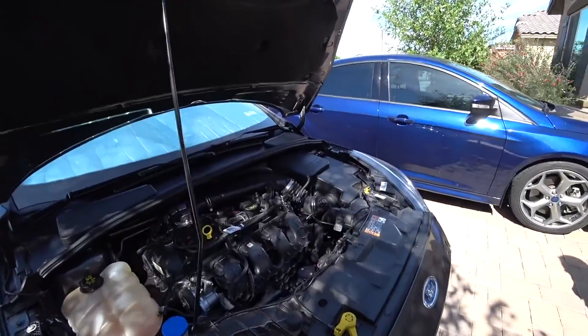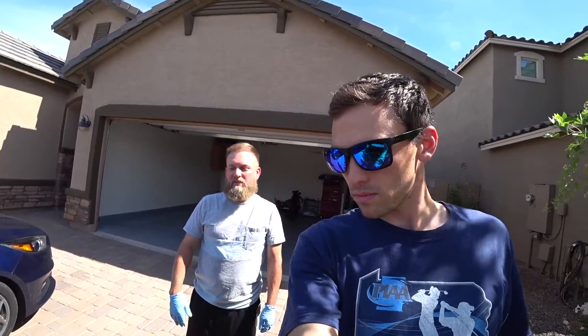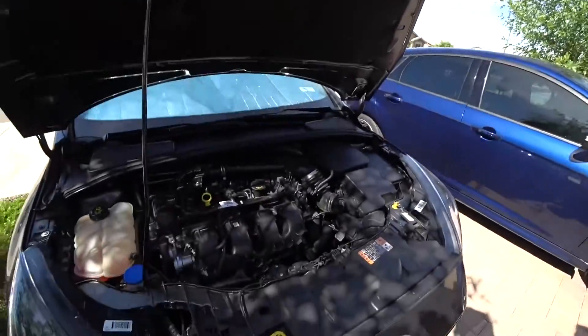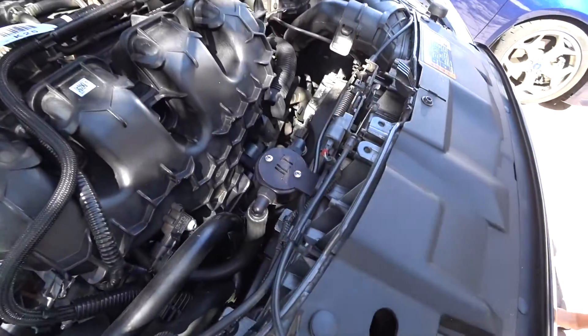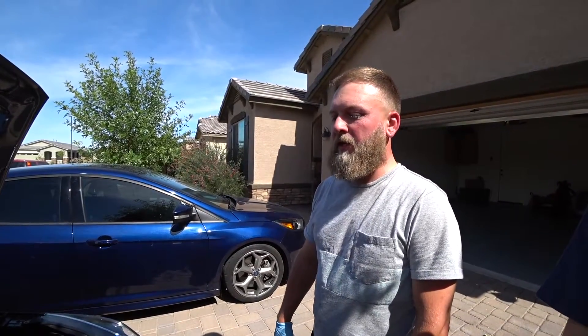I checked the valves again last time I changed the oil and the buildup was significantly less. I've done walnut blasting twice — I actually have a media kit on the shelf. If you know what you're doing it's pretty safe; just make sure the valves are closed when you go in to blast them. The last time I did it, I decided to install the catch can along with it, and it's clearly doing something.